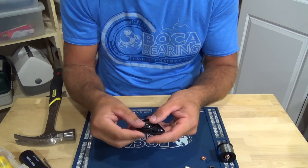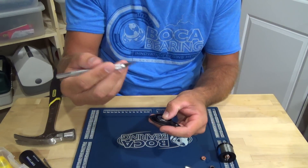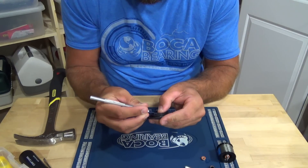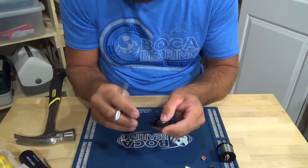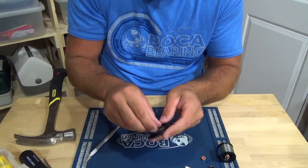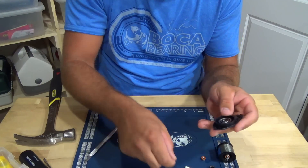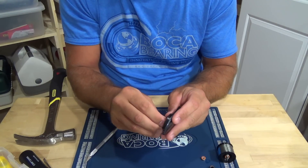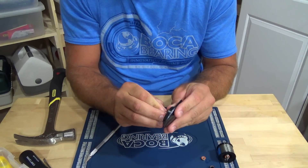Get your side cover — you'll see there's a retainer clip on your bearing. Put your thumb on half of it, then use an exacto knife or a small screwdriver to lift up on the other half. Set that aside. Get yourself a Q-tip, cut the end off, stick that inside the bearing, and pull it out.